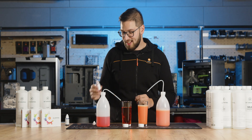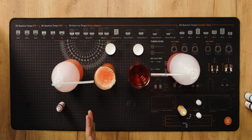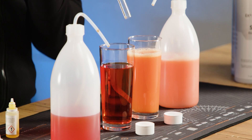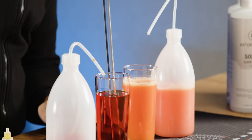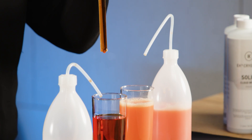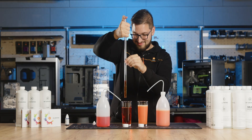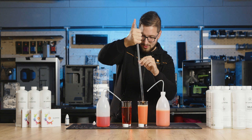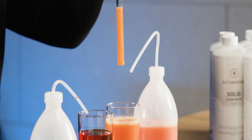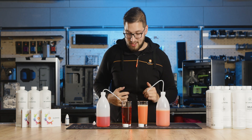Here's a pro tip: before you decide to add any of the second color to your mixture — in our case red — you should check what the coolant looks like in your loop. The water blocks are very thin, and the same goes for the tubing. We're going to take a look at how it actually looks. As you can see right now it's dark orange, but if I raise it, it's a bit lighter. For our solid coolant, it's a bit reddish when you hold it down, but right now it's the perfect EK orange. There's an alternative way to check the coolant color as well.